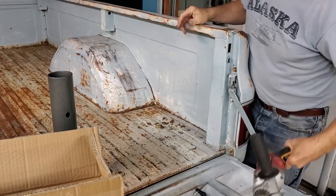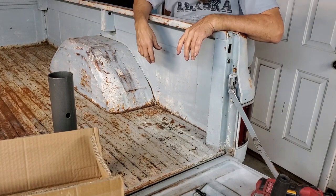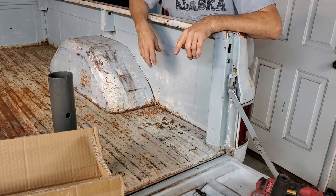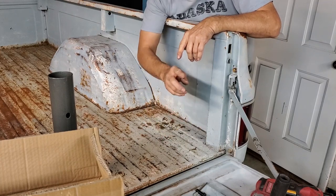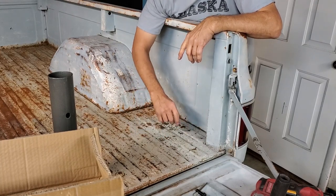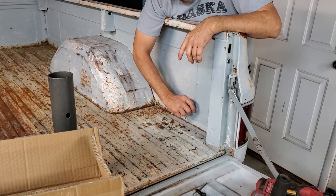That's not necessarily our final hole size, but it brings the hole size up part way. Now what I'm going to do is get the bolts out and we'll resize to the exact final size. The neat thing when you're using a Vari-Bit is it works much better in sheet metal. It doesn't grab like a multi-flute bit does. It's a much better bit to use for it.